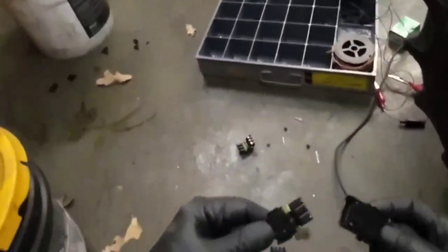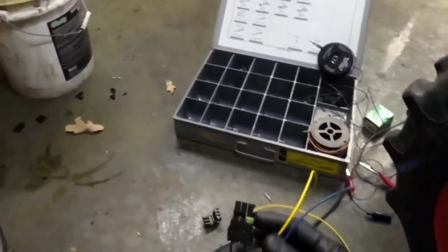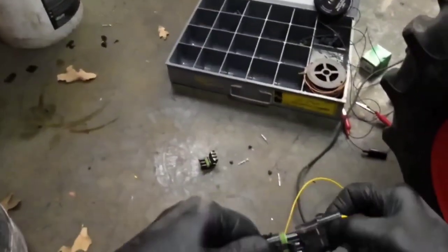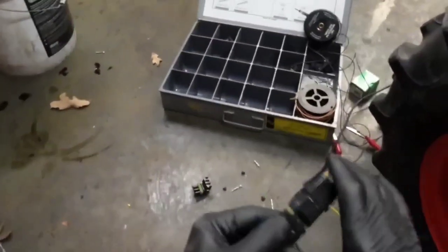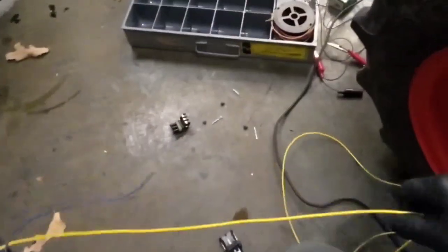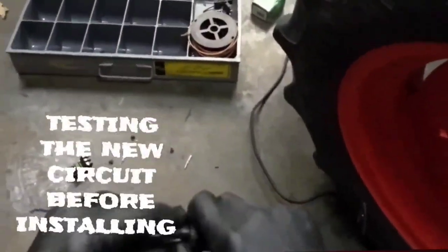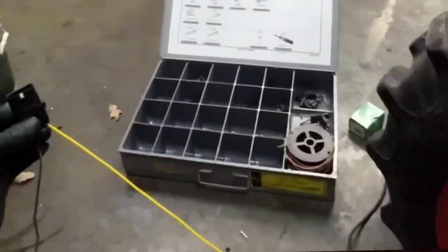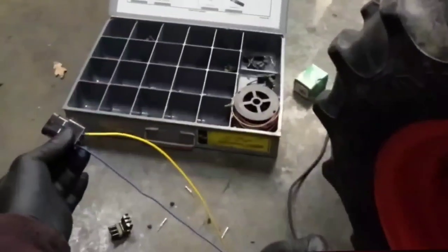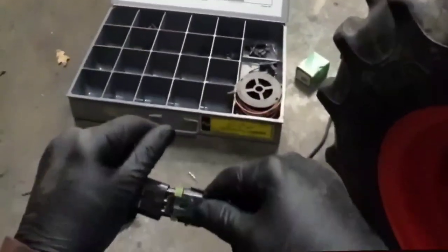I've got the clutch switch wired up. I'm going to extend the wiring a bit, plus this yellow wire is going to have to run along the main harness to bypass that broken wire. Now let's take these connectors and plug them together. Strip a little bit of the wiring off of here. Got the clutch switch — this yellow wire needs to bypass the one that's gone open for some reason, and then this one will hook to the current harness that goes to ground. This is the clutch switch. So let's test our work.